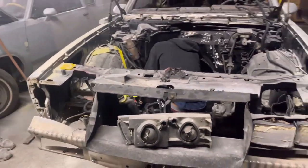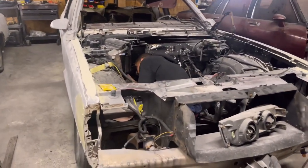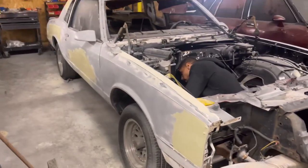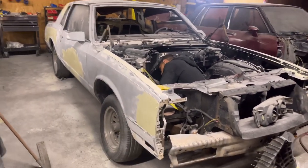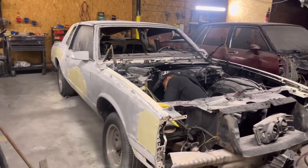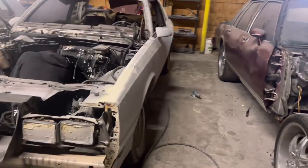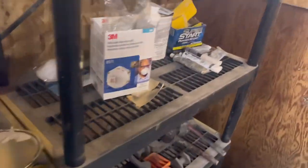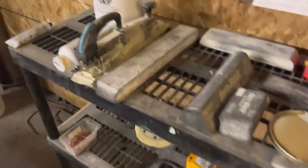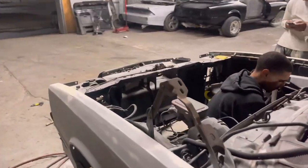Back on the team. My brother's been doing the body work on this — it had a lot of dents and dings in it. Don't be alarmed by the amount of bondo you see — the question is how thick it is, and it ain't thick. We pull it as much as we can with the stud gun and then wipe it. If there are a lot of dents and dings in one area, then the whole area is going to have to be wiped. Look at the bondo station — mainly using sanding blocks. Nothing better than those blocks.